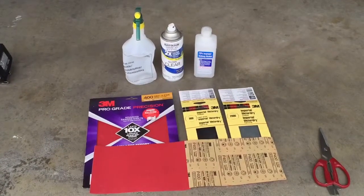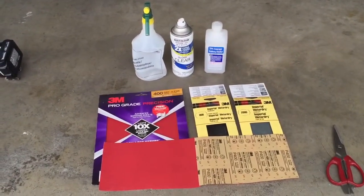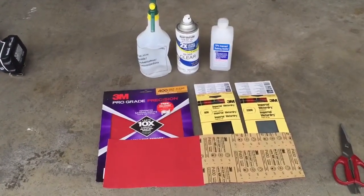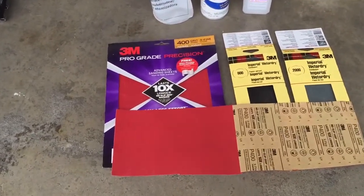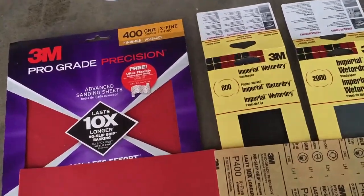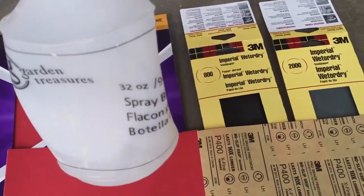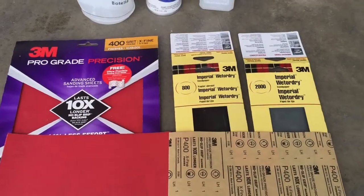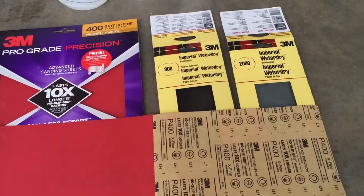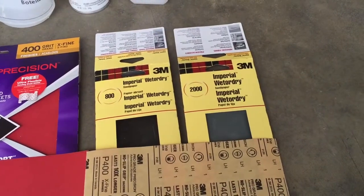I just want to show you what I used to do my sanding on my headlight. Actually, I follow a couple of videos on YouTube. I will put the link in the description. So basically, I start out with the 400 sandpaper, and I use the wet sanding process. So you need a bottle of water here. You can watch those videos for how to proceed with sanding, what kind of movement you need. Then I proceed with the 800, and then the final 2000 grit.